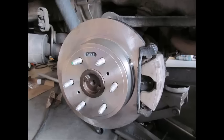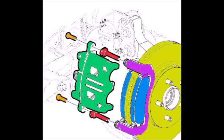If you're having trouble with your steering wheel shaking while applying the brakes, it's most likely one of three things. Looking at this exploded view, I'm going to go through how to fix that in order from least expensive to most expensive. Least would start with the guide pins, which you see in red, followed by the brake pads in blue, and then the rotors in that off-colored yellow.